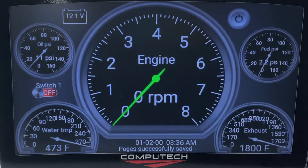When you first get your Datamax system with Prodash, the first thing we need to do is calibrate the Datamax using the desktop software. This is the process where we write down where we have each of the sensors physically installed. We go into the desktop software, tell the software where each of them are installed, and then we send the calibration back via the SD card.